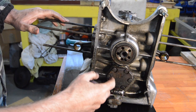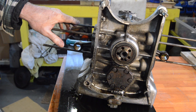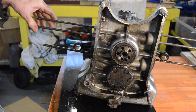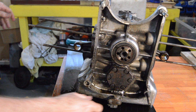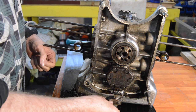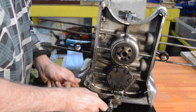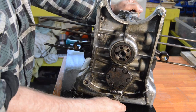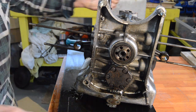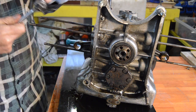So now we loosen these, take the oil pump cover off, and start undoing some of the case bolts, and also take out the oil pressure release and that sort of stuff. So we've got those two - you only actually have to undo one of them for the side of taking off, but I'll undo them both. Oil pump cover is 12 mil.